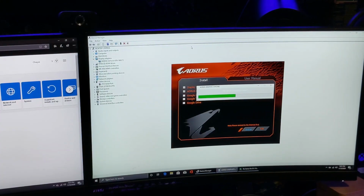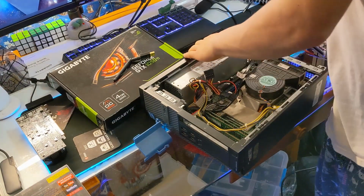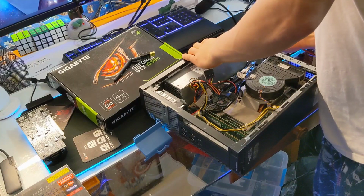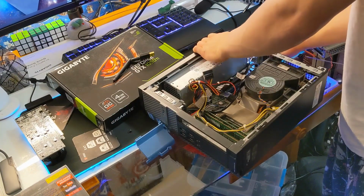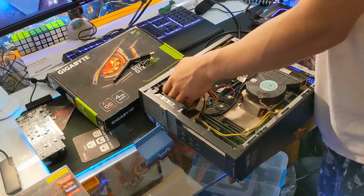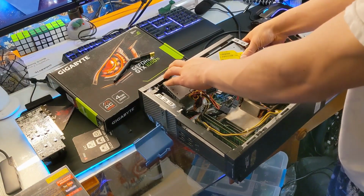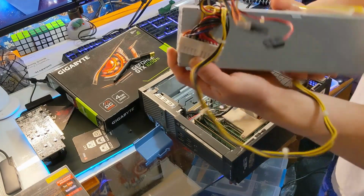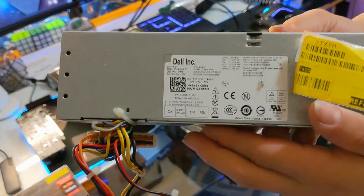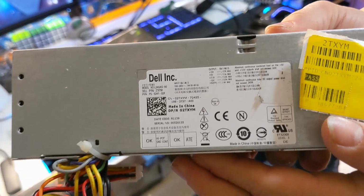And with the graphics card in and the drivers installed, everything is good to go. Yeah, right. It turns out, what I had heard about the 240 watt power supply supposedly being enough for this sort of thing wasn't necessarily true. As soon as the GPU demanded too much power, my computer crashed, which is exactly what happened when I attempted to benchmark it. Granted, I guess that was still kinda my fault for trying to boost the clock speed a little bit, but it hadn't occurred to me at the time that I probably shouldn't do that with such a small power margin.